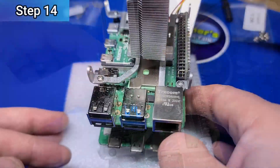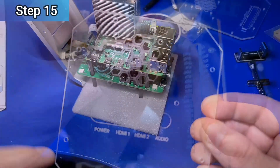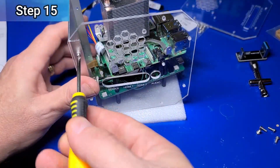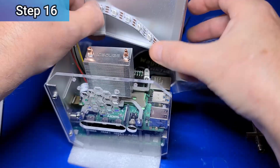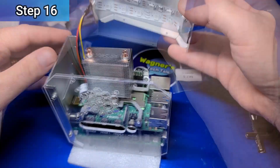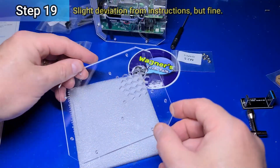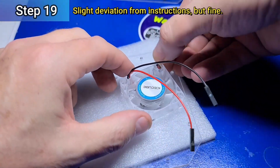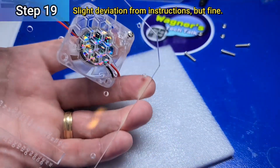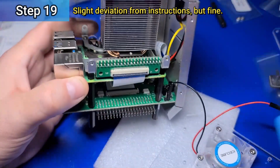Things are about to get more interesting as we begin assembling the sides of the case. Remove the protective backing from the acrylic panel, then secure the acrylic plate that has cutouts for the power, HDMI, and audio to the frame using four M2.5x6 screws. Take the top of the Pyroman case, remove the backing from the RGB strip lights, and position it towards the center of the underside of the metal plate, then align the holes and install the two screws. On the other acrylic plate, install four M2.5 nuts and M2.5x12 screws, inserting the nut into the back of the fan and the screws from the opposite side passing through the plate to the nut at the back of the fan.